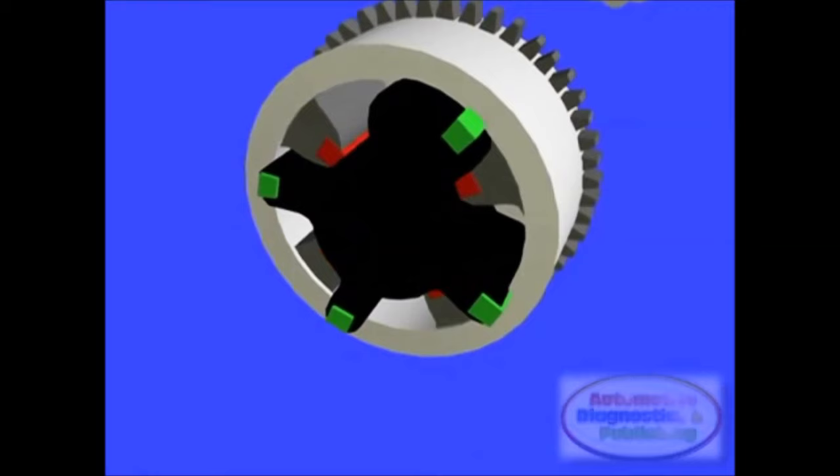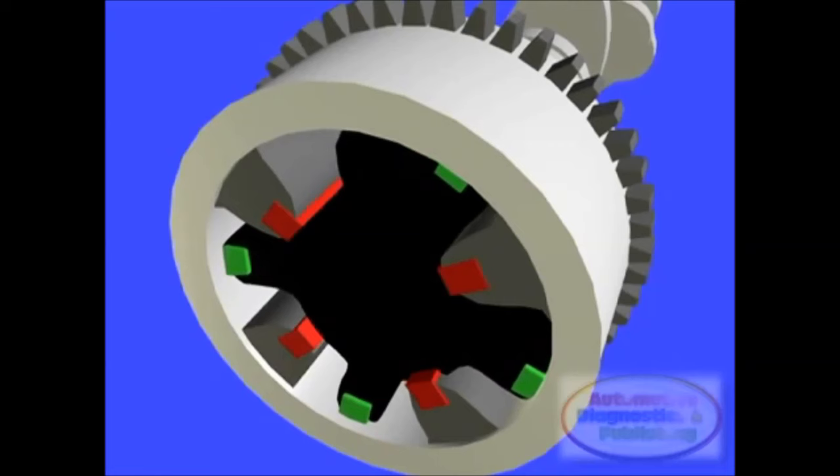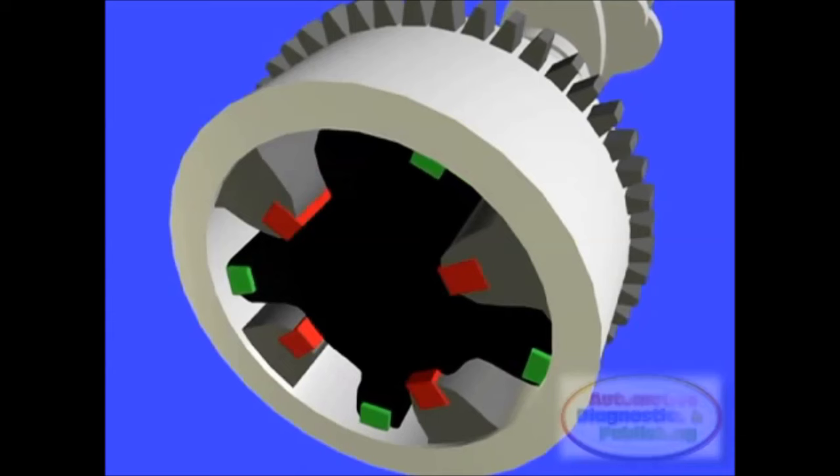Oil seals are used at the rotor to provide a tight seal between the chambers. Discharged oil from the phaser side goes back through the camshaft, through the oil control solenoid, and drains into the front timing cover.